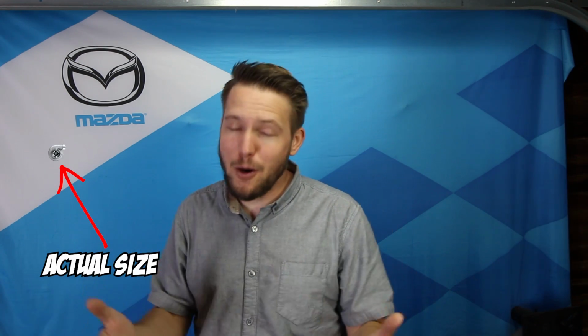Honestly, the car feels really good. It feels way better than stock. I'm a little bit bummed we couldn't get closer to that 200 mark, but we had some things working against us. Number one, which I knew going in, the Mazdaspeed turbo is very small. I know people have done over 200 on it, but Josh also still has a stock downpipe and stock catalytic converter on his car, both of which are huge restrictions on that already tiny turbocharger.